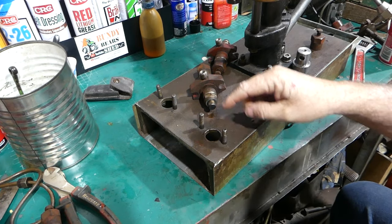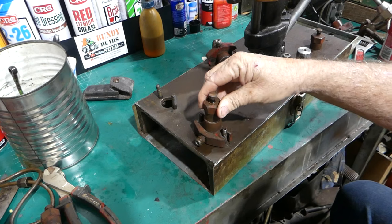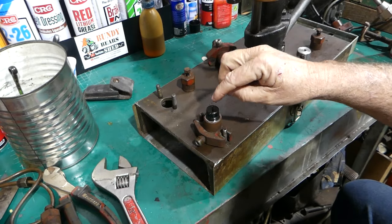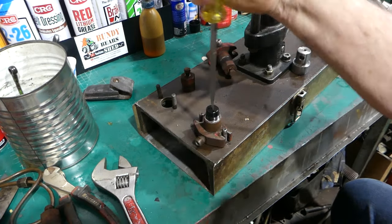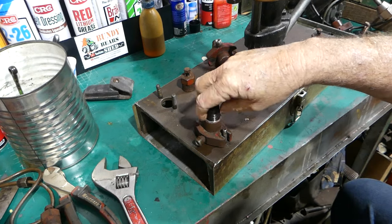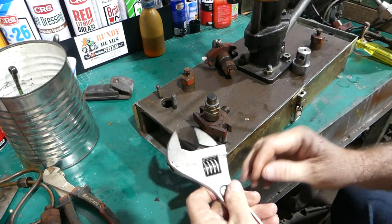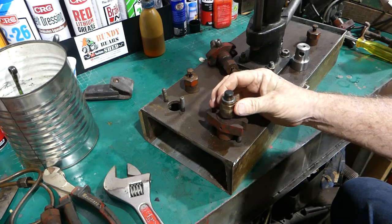This is the other end of my stand — I've just got a couple of studs up here. We're going to pop an injector in and the first thing you need to do if you're going to pull them apart is put them in here and crack this top nut. I'm using a shifter — people don't like that, that's too bad. So we've cracked that, take this off out of the way, and there's a screwdriver slot in the top of the adjusting cap. We undo that and what we're doing is taking the pressure off the nozzle so there's no pressure down below, and now we can get onto the nut here — just a bit of a bump and the nozzle will come off.